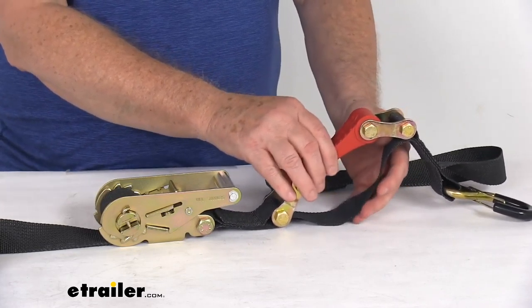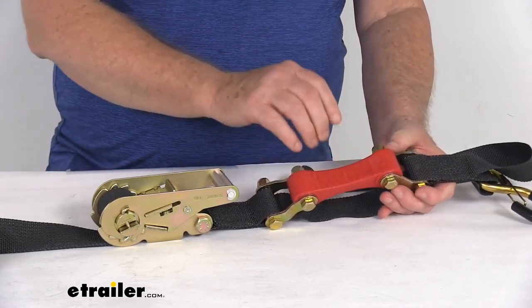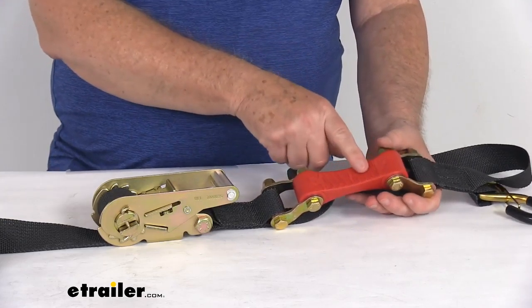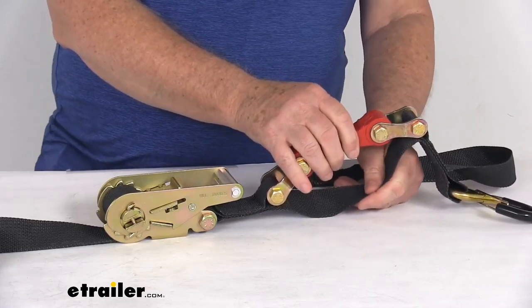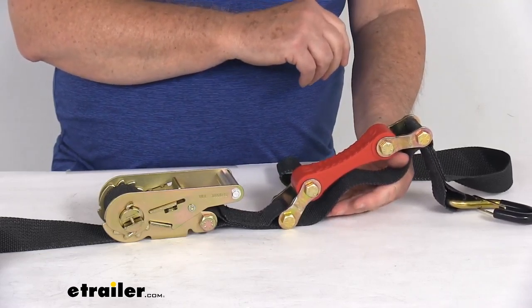The first purpose is to give you an extra strap in case the shock absorber would break. The shock absorber would probably never break, but just for safety reasons they put this extra strap on there. The manufacturer says that the shock absorber would have to be stretched 18 to 20 inches for it to even think about breaking, and you'll notice when you use it and tighten it down that it will usually never stretch hardly anything. The second reason for the safety strap is to act as a limiter so that you don't over-ratchet the strap.